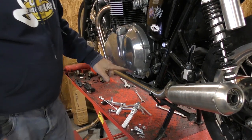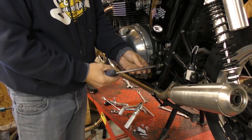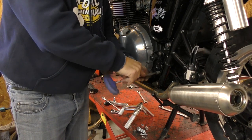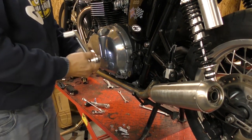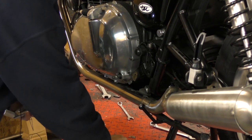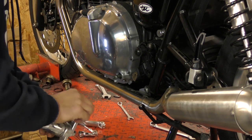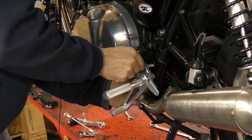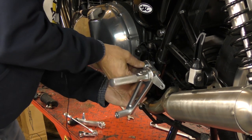On this side you just need to remove the footrest and the gear lever, and these two frame bolts which are already loosened. Put the mounting plate on lightly with the recessed holes to the outside, with your two M10 fine-threaded bolts and spacers going into the frame.